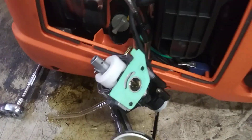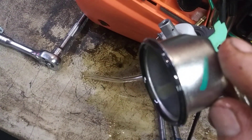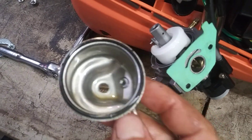I'm just going to flip this upside down and take the bowl off. This one is just slammed full of bad gas — it's not even that dirty. With bad gas, it won't fire. It's just thick. If the O-ring comes out and it's still on that bowl, leave it there. Don't pull it off or it'll swell up on you.